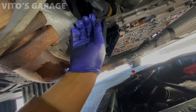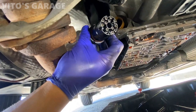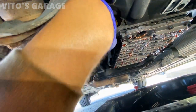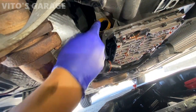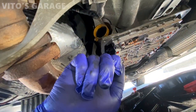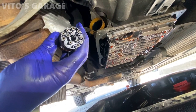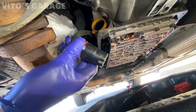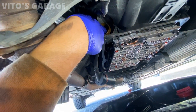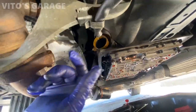All right, so I just undid this plug. I'm going to pull it — look at all this oily stuff in here. That means it was leaking, or at least starting to. There was definitely some fluid in here, so this conductor plug was leaking. We're basically doing this at the perfect time. I'm going to clean this really good with brake cleaner and then focus on taking this guy out — I think it's got an eight-millimeter hex in there.